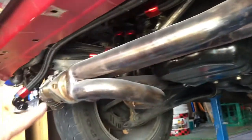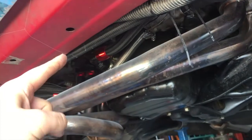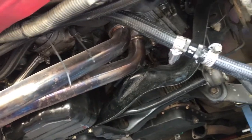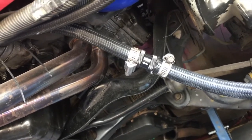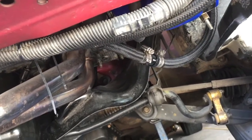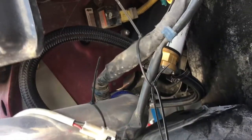I was going to put one from the mini sump up, but the scavenger pump will be sucking, and I'm not sure it can open the valve that way as well as pushing it open. So I'll just stick with one — it's okay if there's a little bit of oil in there. I'll just leave the scavenger pump running for a couple of seconds after the engine turns off. And there we have it installed, hose clamps on. Done — stay tuned for more.